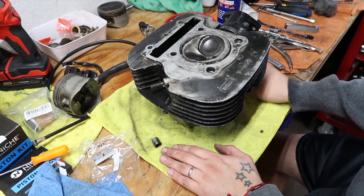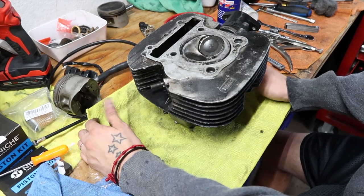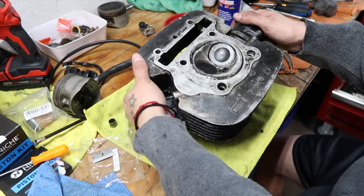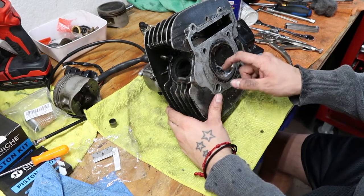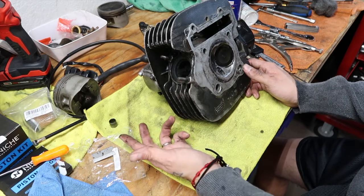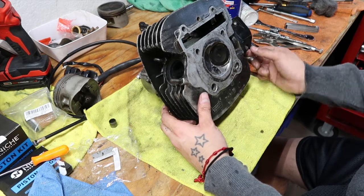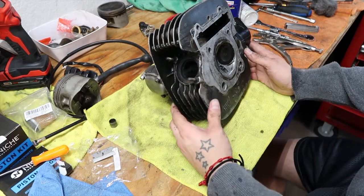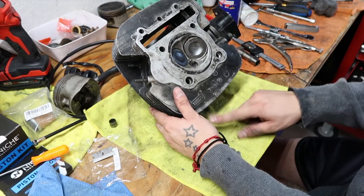because, like we said last time, while we have the engine out, we might as well do that. And then usually these quads have a lot of smoke that comes out just because of the valve guides being bad. It's one of the things on them. Also the ticking from the timing chain. Otherwise, they're pretty good, hard quads that take a lot of damage and withstand it. So other than that, that's pretty much it.